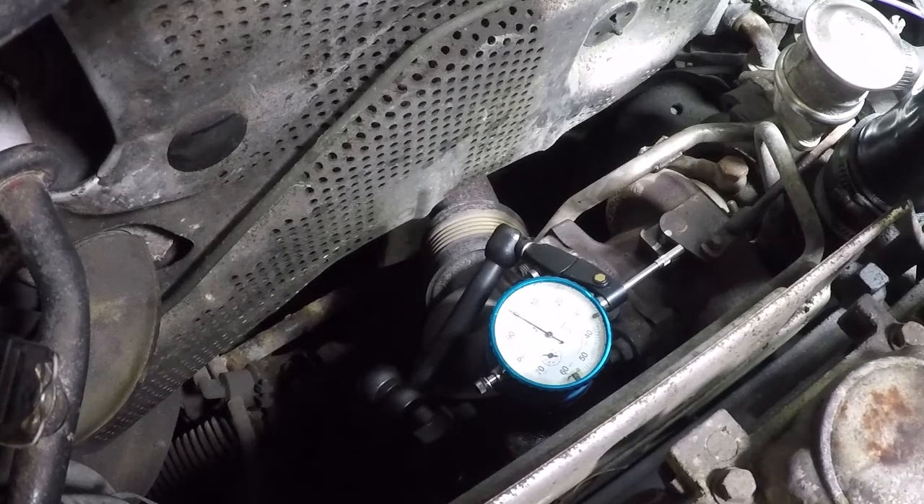Overboosting is going to cause a lot of other problems because you increase your cylinder pressure, you start popping head gaskets, you start bending rods, you start going lean, scorching the pistons. It's supposed to be within a predefined space. This turbo by Volvo was designed to stay in its lane — that's low pressure boost, probably between zero and six to eight, maybe ten on the outside, whenever the electronic control is making that function.